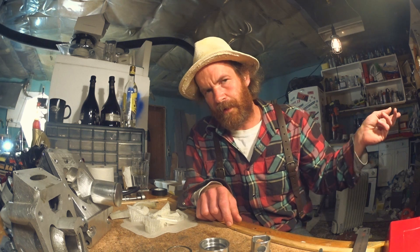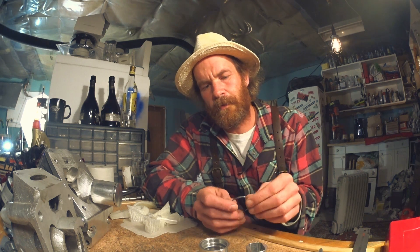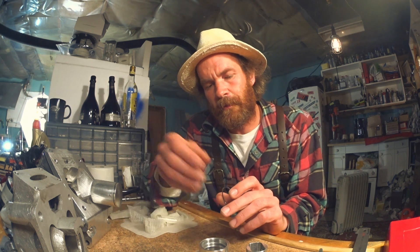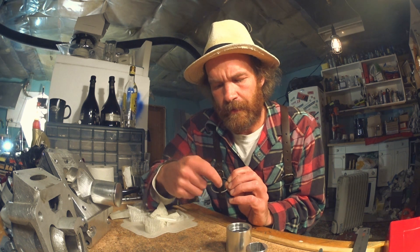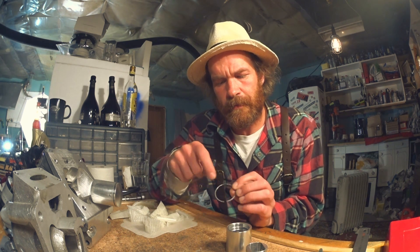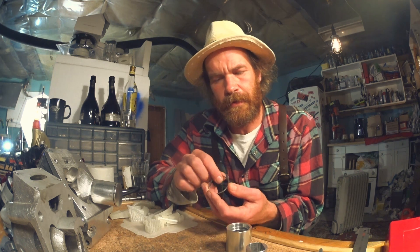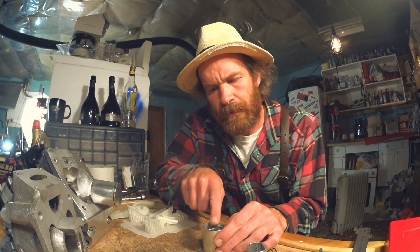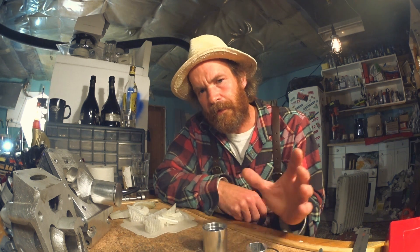Mike, remember I mentioned Ken Sieber on KiwiBiker, the KiwiBiker forum, had some ideas. He had some more ideas, and one of his ideas was exactly the same as one of my initial ideas for this 100% of bore retained ring system. It's basically just a normal ring but with a little tab here and a hole, and in the piston there's a pin slightly smaller than that hole. The pin is retained through that hole and serves the same function as the ledge. The advantage is that the ring groove can be exactly like a normal ring groove except for a small notch where that tab has to sit, and that should make it act very, very close to a normal ring.